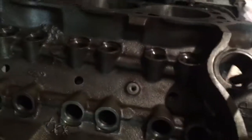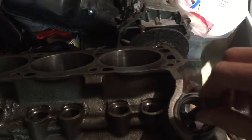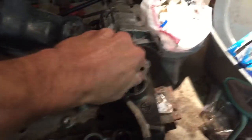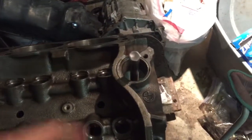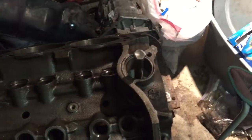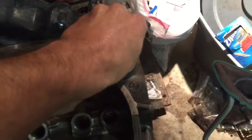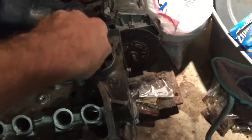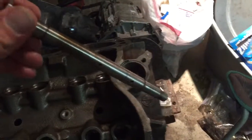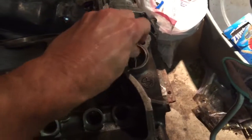Let's see if I can get a picture here. Makes sense. This little guy will go down inside into the hole in the bottom, and then mate up with that hex-headed shaft, and then we'll be able to just use a hand drill with a 5/8 socket on it, and we'll be able to run the prime up on that oil pump counterclockwise. So I got that ready to go anyway, and we'll use that whenever the time comes. So now I have a 302 oil pump priming tool.